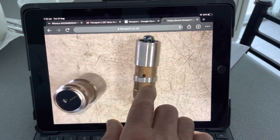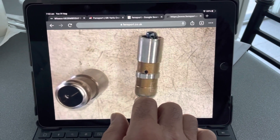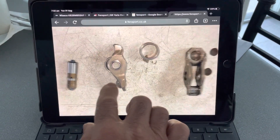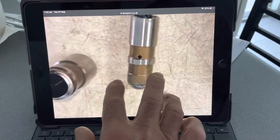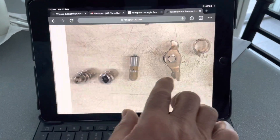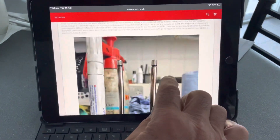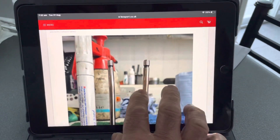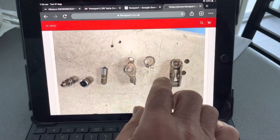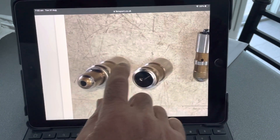The best thing is to make some solid lifters, and have the same arrangement to adjust the valves as the FA20 engine. You'd then run a little bucket — they've already got a little bucket, I'm pretty sure, on top of the valve stem. So you'd then have that as your adjustment — a little shim to adjust the clearance, or you can do it on the bottom of the pivot.